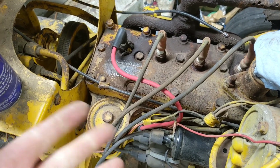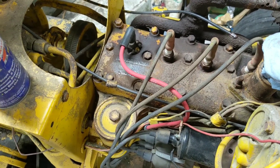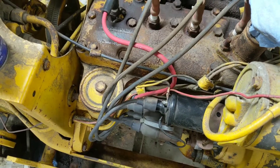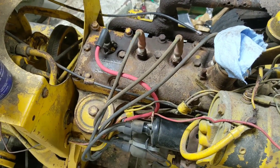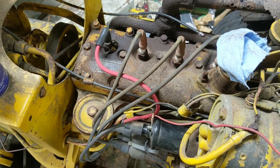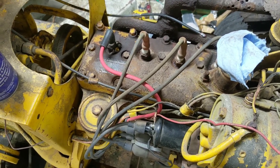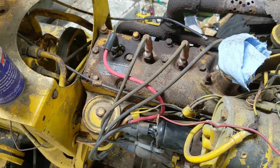There you have it — some custom wires for maybe an old vehicle or an old tractor that you can't buy wires for. Don't be afraid of it, it's not really that hard — it's pretty simple once you know how. Now I've got three other wires I need to do and also the coil wire, and this tractor should be one step closer to running. If you like these types of videos please like and subscribe — take a look at my other videos, I like to build a lot of things and you might find something you want to build too.